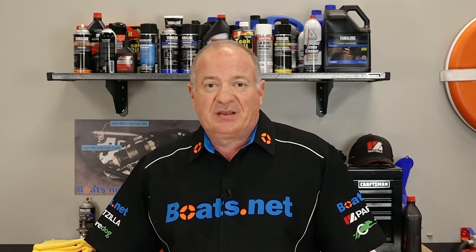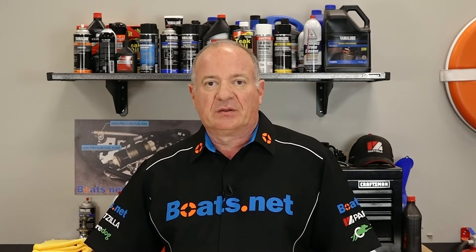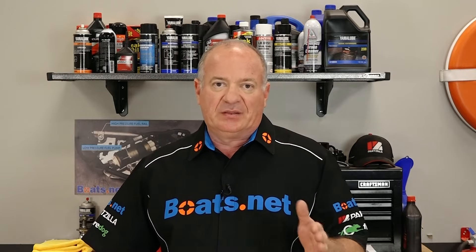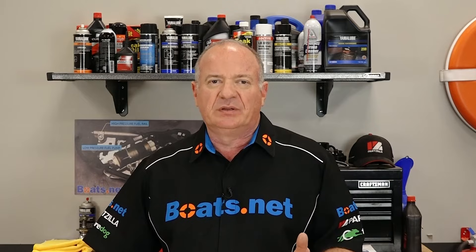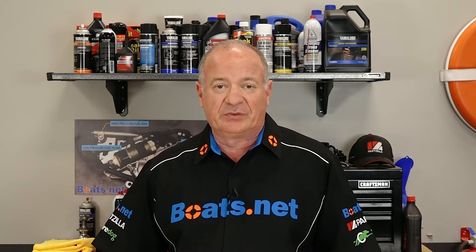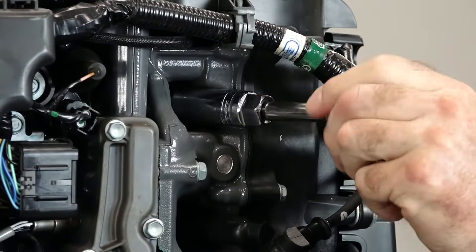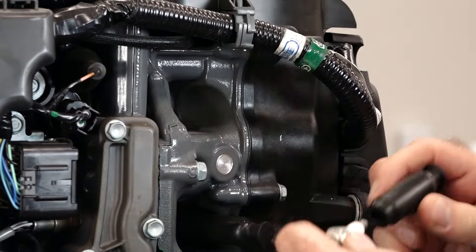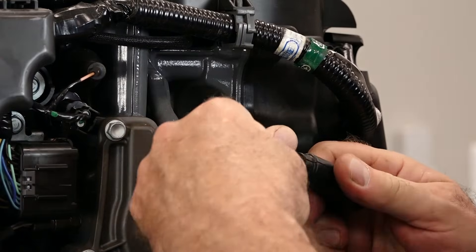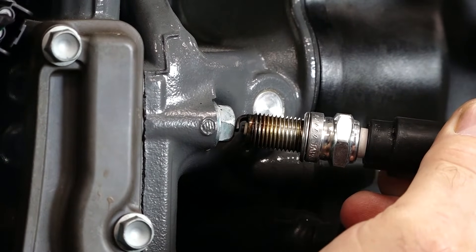Now you've done a visual inspection and you've confirmed you have power getting to the spark plug — all that's left is to actually see if it's making a spark. To do this, reconnect the spark plug wire to the spark plug with it pulled out. Keep it out and then put it on a ground somewhere on the engine. But before you do this, make sure there isn't anything flammable around because you're about to bring a spark into an environment, and believe it or not, that can ignite if you've got any type of open fumes nearby. Also, keep it away from the spark plug hole itself because there may be some unignited fuel in there that may come shooting out and make a nice little blow torch towards you — I don't think you want that either.